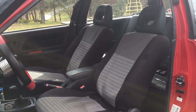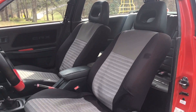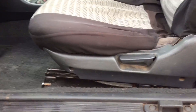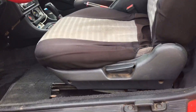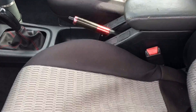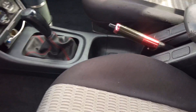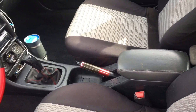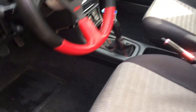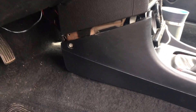Inside, I actually have EK 96-to-98 seats with some gray Integra headrests — it was a straight bolt-in, I just had to put a spacer like a big nut up front to space it out for bolting. I've got some cheap black and gray seat covers and the Integra center console in here. It was a pretty easy fit; I need to do a little trimming to get it butted up better, but for now it's got a slight gap and fits very nicely.